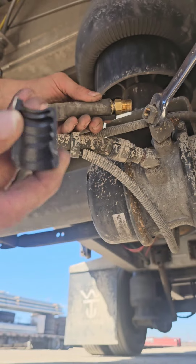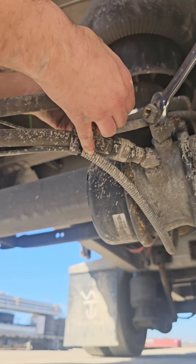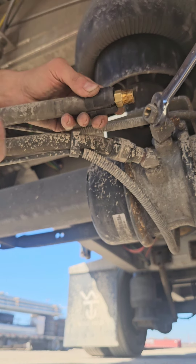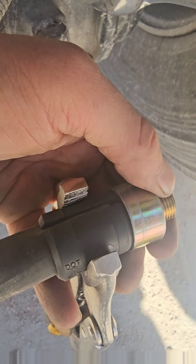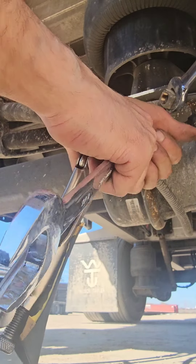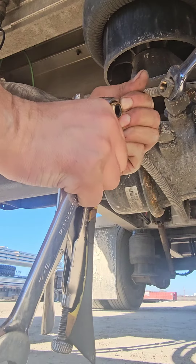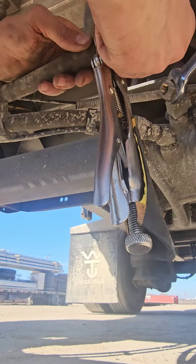Just like that. Then you're going to slide the collar in, but you've got to squeeze this really hard before you do it. Vice grips will hold it together, and then you've got to get this ring on there. I like to take the open end of a seven-eighths wrench and squeeze it onto there — sometimes you've got to tap it with a hammer.